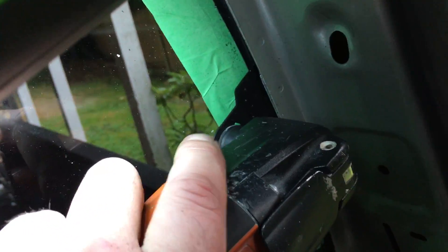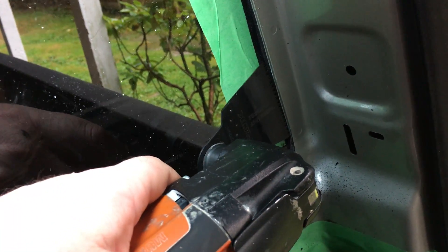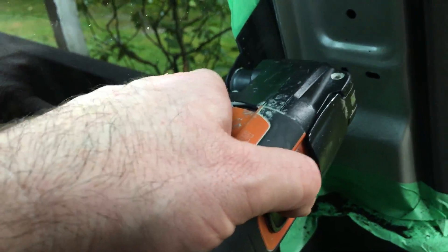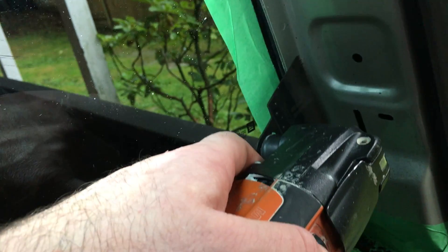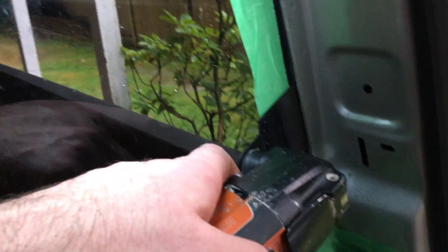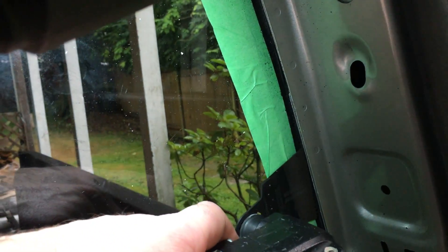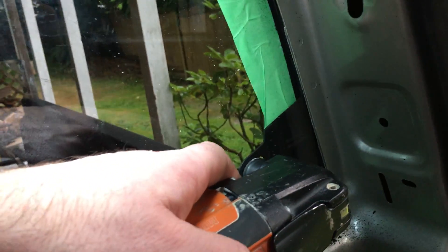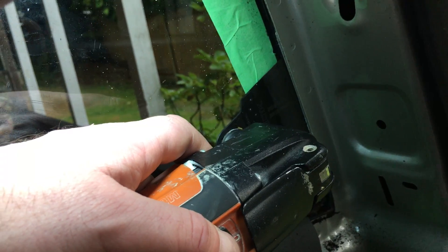When you get through, you can see it's cut through already. The trick with this tool when cutting is to go in at a sixteenth-of-an-inch angle — angle it out. You don't want it to vibrate against the steel frame. Keep it angled out slightly so you don't take off the paint on the back side of that frame, because that would cause rusting and the polyurethane won't stick properly. Push in a sixteenth, make a pass, push another sixteenth — now it's an eighth — and repeat until you're at a quarter to three-eighths inch, which is the thickness of the polyurethane.